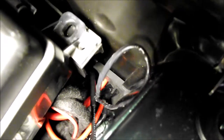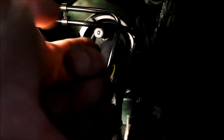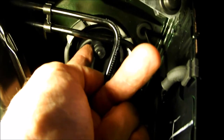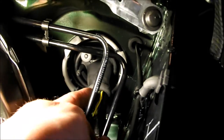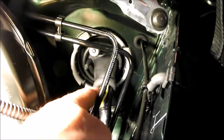Now we have to put the wire through into the engine compartment in the same location where this red wire entered. The loop is pulled into the engine compartment. I should have routed this through the grommet right here by cutting the end of that instead of going through here — I was kind of hard on all the wiring to pull it through, but it should work fine.